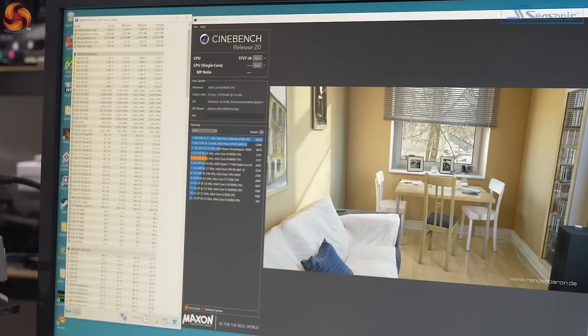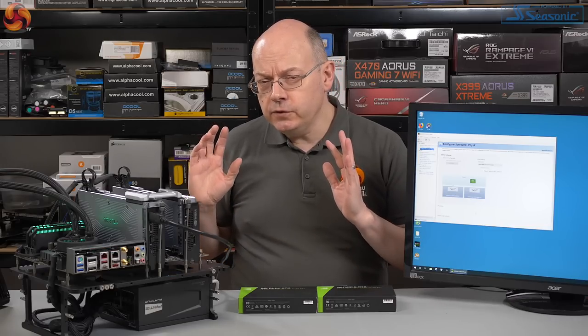We're doing considerably better than out of the box, but that speed label is junk. CPU performance out of the box is not good because it throttles like crazy. That said, many tasks — plenty of games and 3DMark Firestrike — are not massively CPU intensive; they're more graphics intensive. If you throw a proper CPU-intensive task like Cinebench R20 or Blender at this motherboard out of the box, performance is abysmal because of the power cap. Unlock the power carefully and you can be okay; be a bit rash and it's a blue screen.